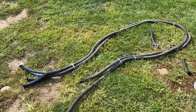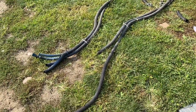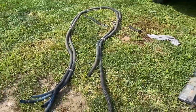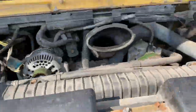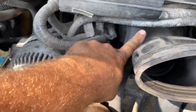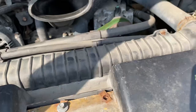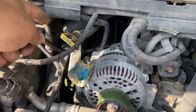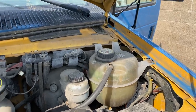Been waiting to do that mid-chassis heater delete. I know I probably should have kept it in there because when you're driving you can have the heat rolling from that, but we're going to put a diesel heater in there so it's going to run off the fuel tank anyway. Didn't really have anywhere to put the original heater so went ahead and deleted it. Very crusty in here after painting but just routed the hose — they had coolant shut-off valves one here and one here. Ended up being able to take off this one that came up to a valve, cut it down a little bit, and slapped it right back onto the heater core.